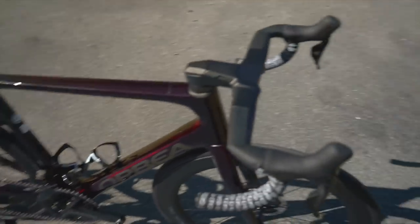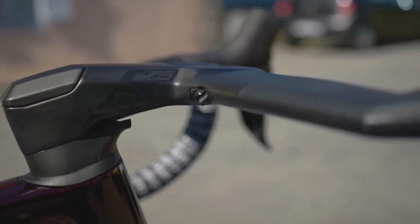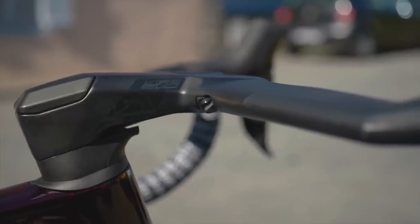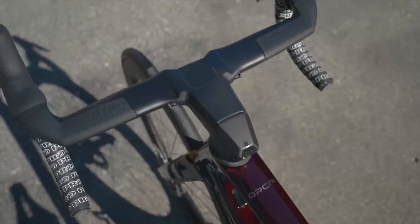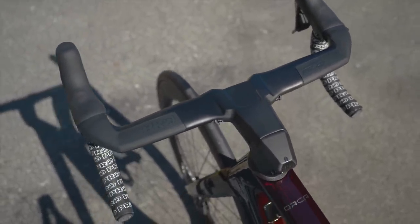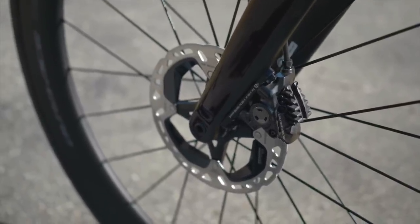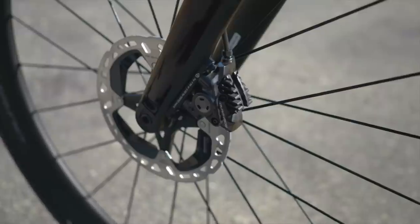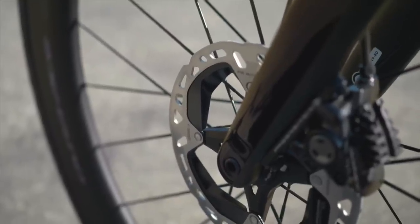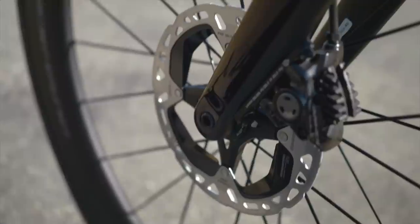at this moment, what I hear, at least from the bike makers, is they are on par with what was out there on rim brakes because of integration. Disc brake, yes, the caliper itself might look rather bulky at that place, but if you see what you can do with the frame and the fork and the integrated cables, much more easily than you could ever do with a rim brake with mechanical cables also sitting there in the front. Then what I hear from our partners is that they're on the aero side already on par with that.